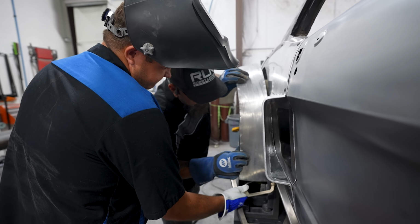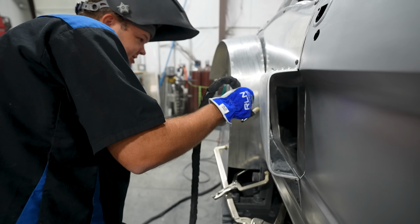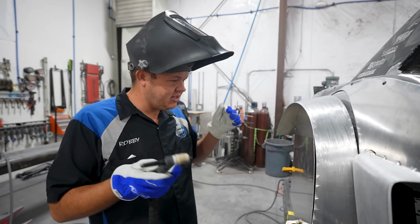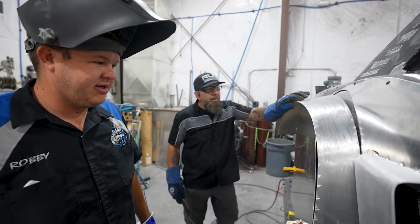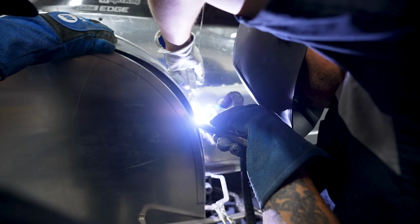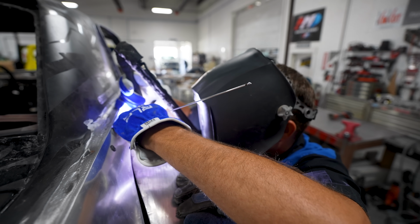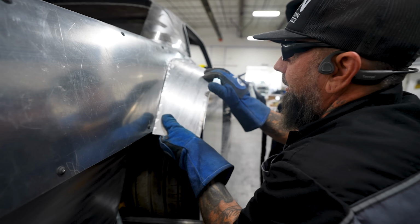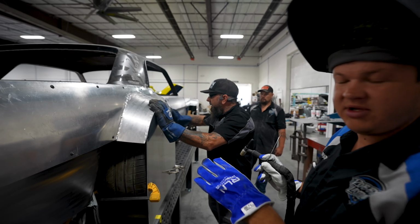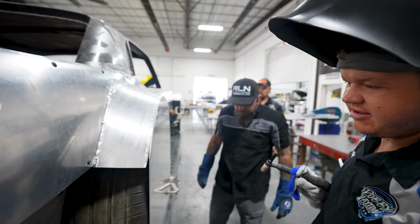Ready? This is going to be fun in here. Basically what we have to do is bring the tungsten way far out with not a lot of gas and just try to feed weld down in there. Yeah, that'll be fun. There we go. All right, we got that tacked. Now we're a little bit disformed. We're gonna hurry and work this a little bit, get it to fit a little better, and then tack the outside.